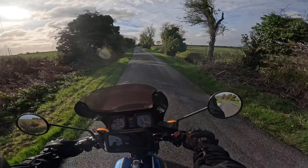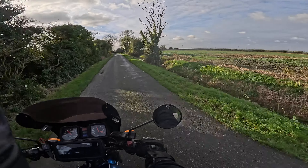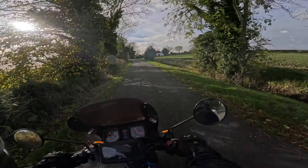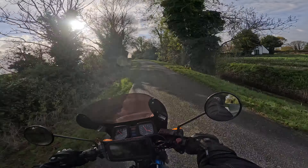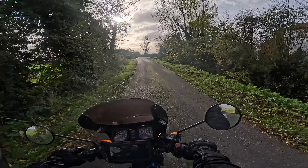I can't remember the torque or the weight off the top of my head, but they're not heavy — 130 kilos maybe. They're a lovely little lightweight thing. Single disc on the front, drum brake on the rear, single carb — I think it's a Keihin, can't remember the size — but it's got an accelerator pump on it. 12-volt electrics, headlights not particularly good.